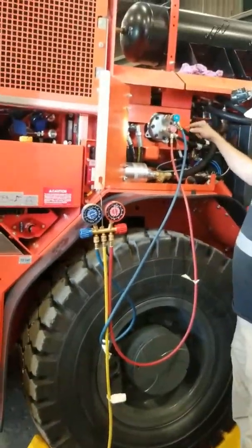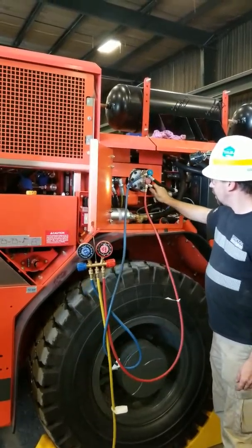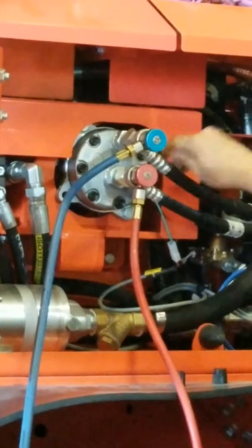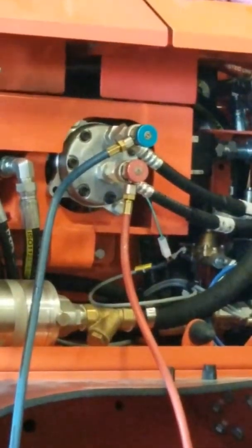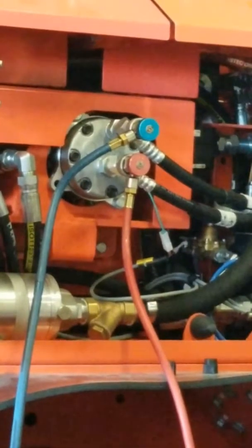The hose is a good indicator for you. The high side is too hot. The cold side has frost on it like this, and if you see a dripping curve off it, that means the system is overcharged. It's too much — too much liquid.